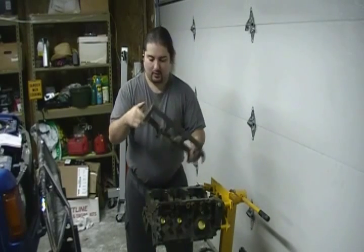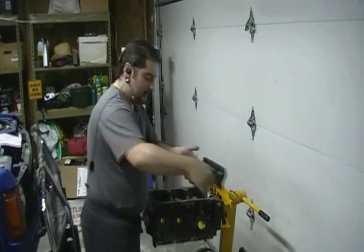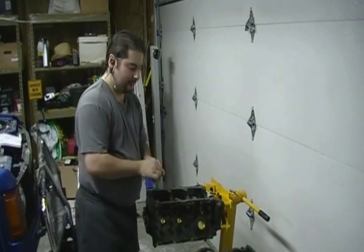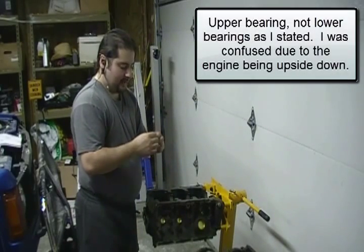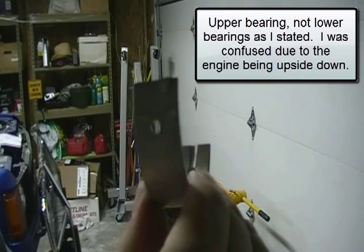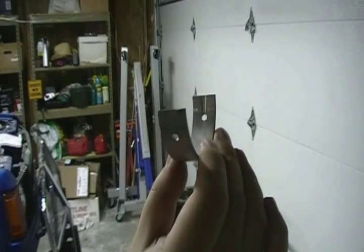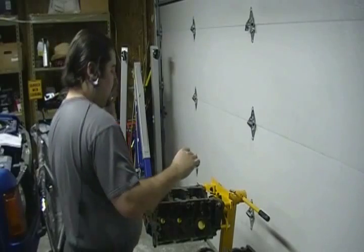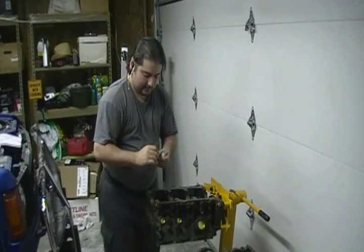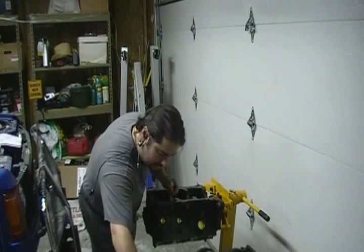The bearing cap has these little grooves and the arrow on the front that will help you orient it when you put it back in. The next step: we've got the lower bearings and I'm going to install them first. The lower bearing itself has a very slight little groove on one end — it doesn't have it on the other end. That little groove fits into the groove that's milled out of each one of the bearing locations. I'll just roll it a little bit in motor oil as I'm assembling this.